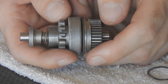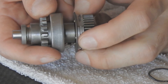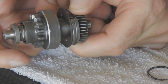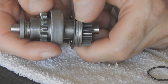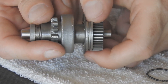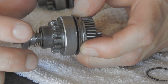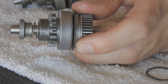The difference from a normal starter Bendix and this one are these collars back here. When the ring gear engages with the engine, centrifugal force of this shaft spinning forces these collars out, which then blocks the ring gear from going back into place. That's necessary because when our engines get to top dead center, the compressed air actually pushes them back down faster than this starter is spinning. As a result, the load on the ring gear that keeps it out goes away, and it drops back in place — and then you have to do it all over again, only able to spin the engine over once, which is not enough to start it.